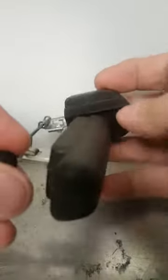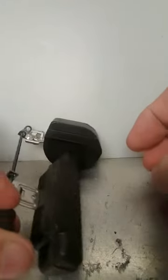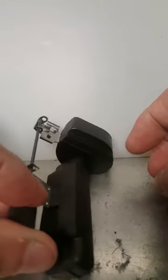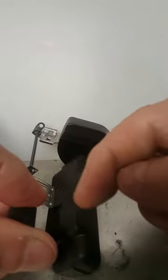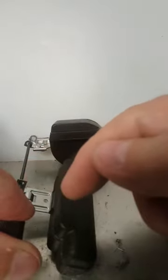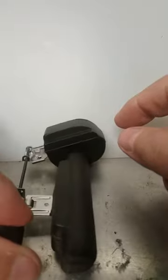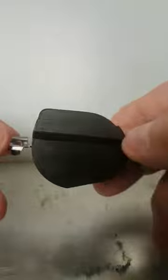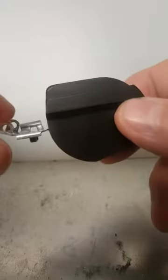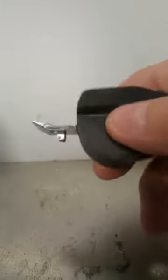It's how much distance from the fulcrum there is out to the edge. If I rotate the fulcrum, you can see that the center hung float will drop more because of the length between the float and the hinge pin. The side hung float, because of its height and length, doesn't really give you as much angle change between the hinge pin and where it would support the needle and seat.